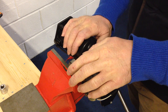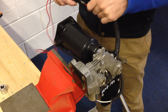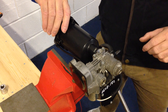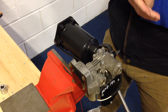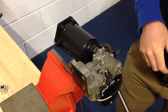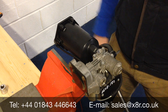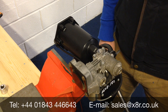At this point, it's a good idea to test the compressor on the bench to make sure it's working properly and the install has gone well. To do this: red wire to positive battery terminal, black wire to negative battery terminal, and just run the compressor. Where the air is outputted, put your thumb over that — you shouldn't be able to stop the air coming out. Where the air is sucked in, put your thumb over that — you shouldn't be able to stop it being sucked in. If you can stop it, that would indicate a problem with the install. If you can't, the output is good. That completes the install of the piston ring and the glide ring. We'd always recommend replacing the filters in this unit also — we have another video showing how to do that. Thank you for watching. If you have any enquiries, call us on 01843 446643 or email tech@x8r.co.uk. Thank you.